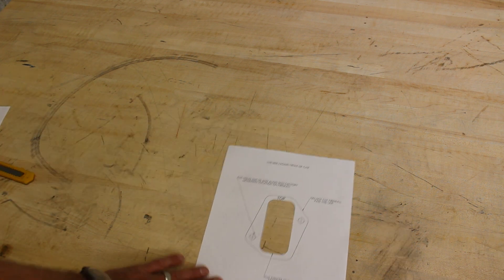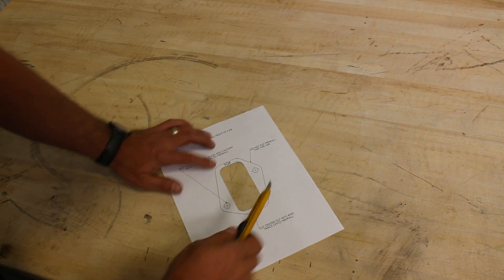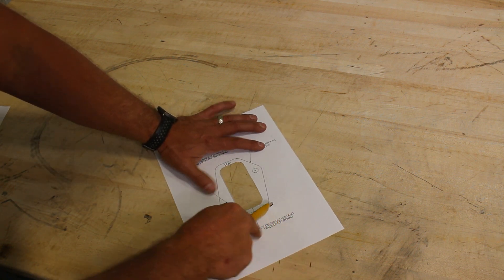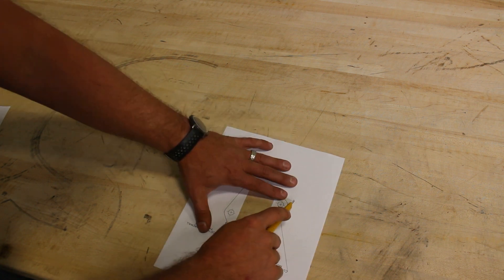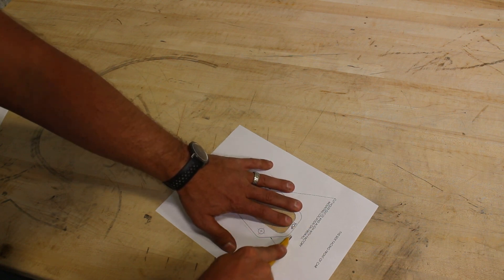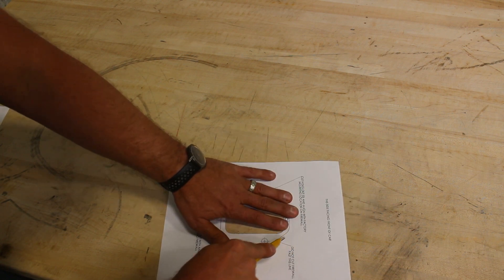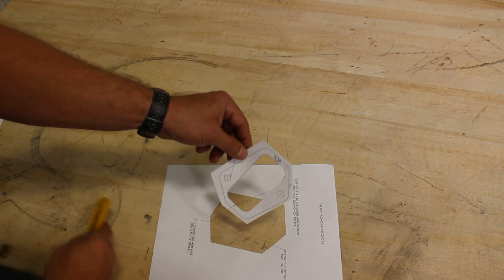So this is basically what it's going to look like when you're done. We're going to scribe or use a Sharpie to mark this inner diameter that we cut away, just knowing that we want to make sure that line is completely trimmed off and nonexistent anymore. Because if you don't do that, it's going to be real tight on the sheet metal and it's going to rub on the way in. There's a little room for error around the outside here, just keep that in mind. To make it a little easier to get the template in and out of the car, you don't need all this excess on the sheet, but this outer line isn't necessarily important, so you don't have to be real careful with where you're cutting on this one. Make sure you've got enough room. So there's your template we're going to actually use.